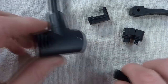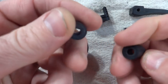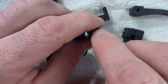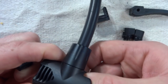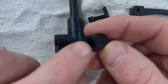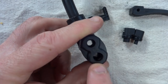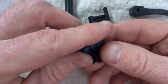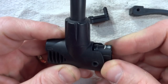To put this back together: there's a small hole and a larger hole, so the Presta valve goes there. I can tell by how they're worn — this part has a slightly smaller hole, so it fits down over the Presta valve side. Just push it down in. Then this part goes on the Schrader side, so I'll put the large-size hole facing down and get it shoved into place. With the little rubber ball sandwiched between the two parts, I'll slide these down — the plus side goes on the Schrader valve side, and the hole part goes down the Presta valve side.